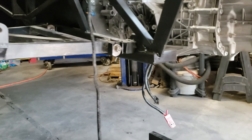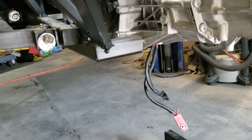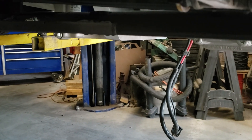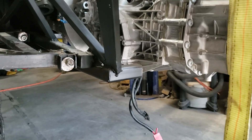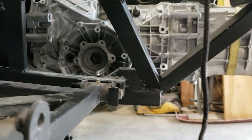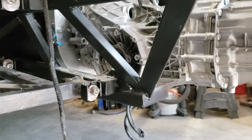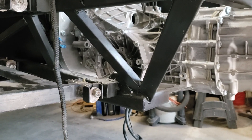Running into some problems. Where I've got the motor situated, it's too low for the transaxle to fit. I cut it out thinking I could do that, but in reality I need to raise the engine up. The oil pan is slightly below that frame point. The Audi transaxle is different than the Porsche transaxle, which is what I had initially done — I was thinking the measurements were the same, but they're not. The axles are really low, so the whole thing's got to come up. That means pulling the engine again, putting some extensions on the motor mounts, and trying again. It gets frustrating at times, but you've got to do what you've got to do to make it right.